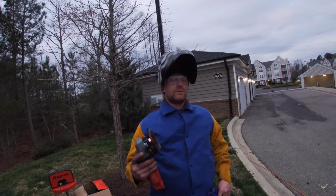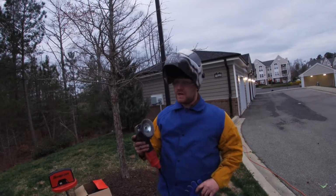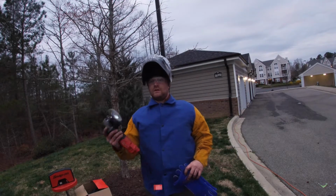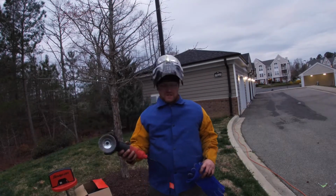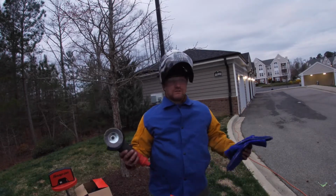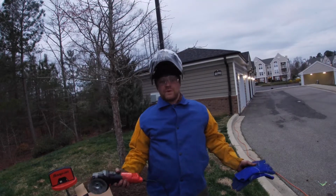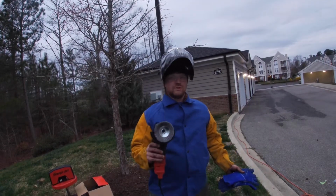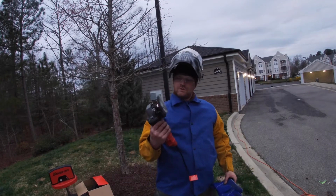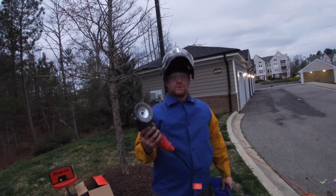Now I have had one of these explode on me. I haven't had one this big explode on me, but I did have a Dremel one explode on me. And it got all of my clothes. I got very lucky that it didn't get in my eye, and I could never get the shards of metal out of my clothes, so I ended up having to throw them away. So please be extremely careful whenever it comes down to you using a wire brush. And make sure it's rated for whatever tool you're using it on.